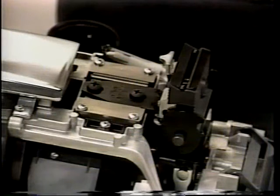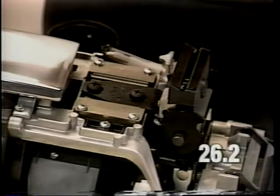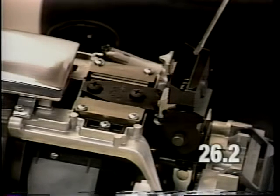If the handle fork falls down, make sure the paper bag is not full of dirt and test with the cord off of the cord hooks on the handle fork. If the spring is weak on the handle pivot assembly, replace the handle pivot assembly as described in step 13 of the video.